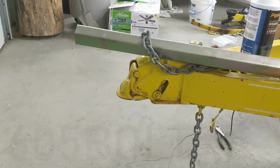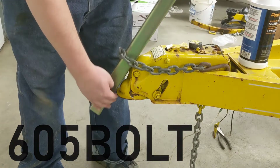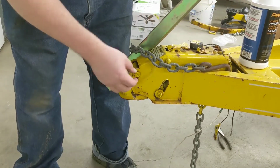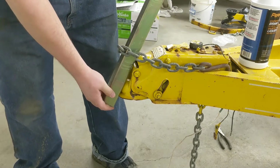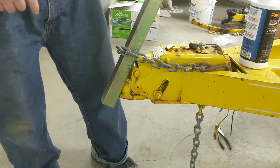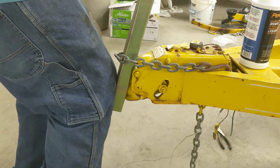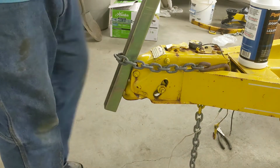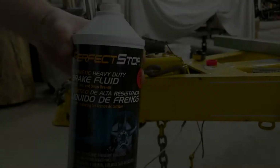Okay, so I'm up here at the front of the trailer, and I'm basically looking for a way to pump the surge brake piston, the actual master here. So what I got rigged up here is I just took one of the chains and looped it back so that now I can just go like this and get a good pump on it and hold it forever, and then actually let it back off, and then you just gotta pull back to get it to undo.